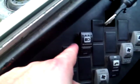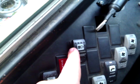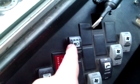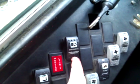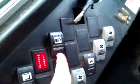Close the door here. The switch is already on to accessory. So what's going on is this switch right here makes a circuit to the switch to red when door is open, flash red when door is open. That's the wire this switch is in series with. So when it's off, there's no load lights that come on, except the ambers. It'll go to ambers, but it will not switch to reds.